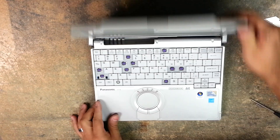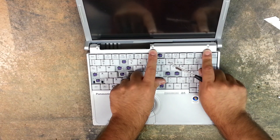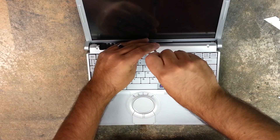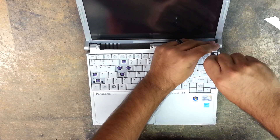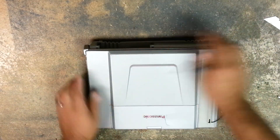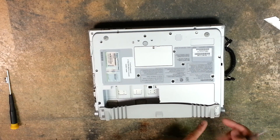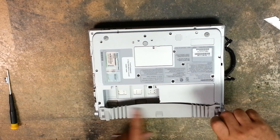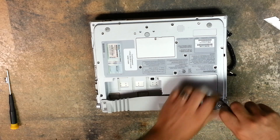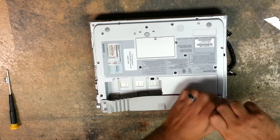To remove the hard drive, we have to open the computer up. On the right-hand side there are two screws to the right of where the battery slot is, so we remove those two screws. Close the lid and flip it over. We're going to remove the two screws that hold down this rubber strap to the right of the battery — I leave the ones on the left because we don't really need to remove those.